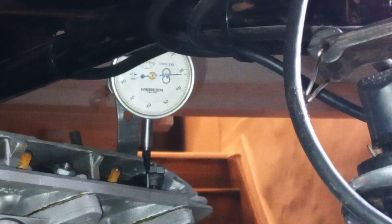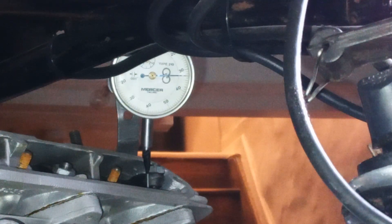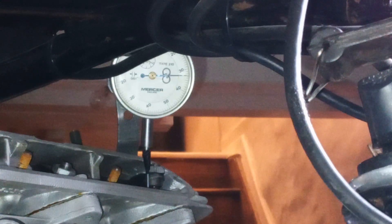Being 18 thou short means we need to adjust. You can only change these by 17 degrees — there's no finer adjustment than that. So in theory, if I move the cam pinion round by one keyway, that should increase it by 17 degrees and we should be on almost exactly 150 thou opening. We're going to take the pinion off, move it anti-clockwise, put it back, check the timing again, and hopefully it'll be just about spot on 150 thou.